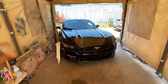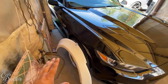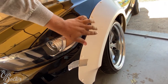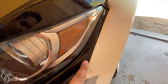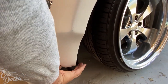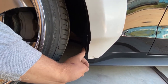I've got to figure out how to do the best cuts, how to seal up the rear, and figure out the kit fitment. Although it has cutouts for the headlights, they don't seem to line up perfectly, so I have to decide what body lines to work with to make it all flow and not just look like a body kit slapped on. One of the biggest issues with wide body kits is if the arc doesn't match up and you get a weird gap — it's never gonna look good. You need to make sure it's flush with the actual body arc.